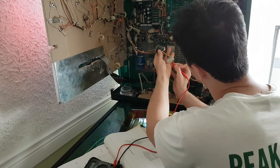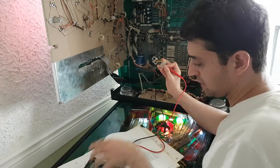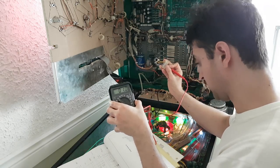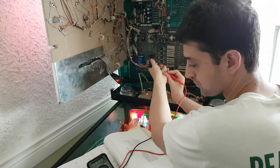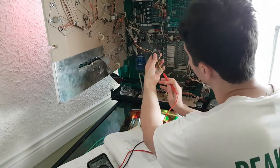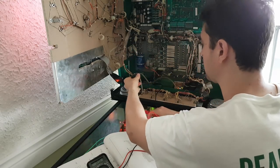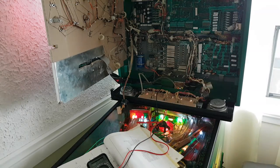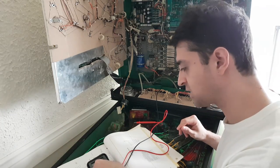The five volts are working, ground is fine, the 12 volts at 16 are apparently okay — so everything seems fine except the high voltage. It's reading 1 or 1.3 volts, and it should be plus 67 volts. So: ground your multimeter, probe the violet wire, and it should read 64 volts. That's why the DMD is not lighting up. Let's turn this off.